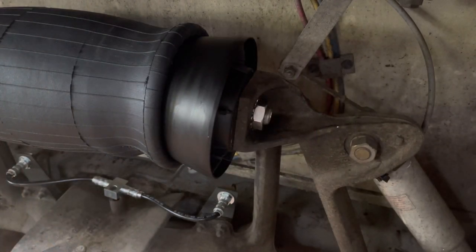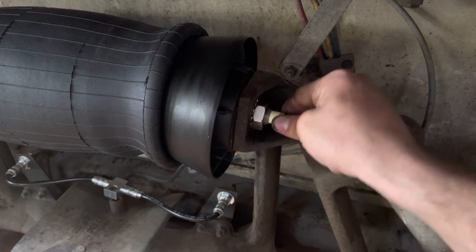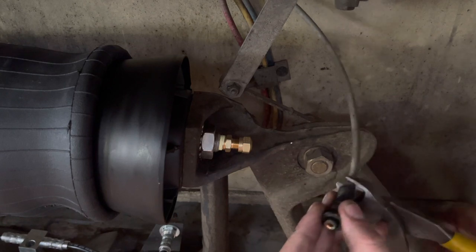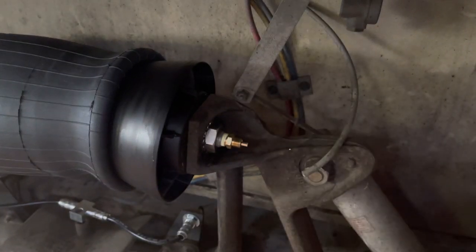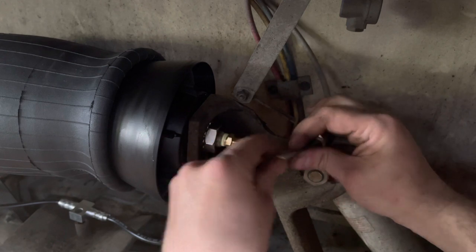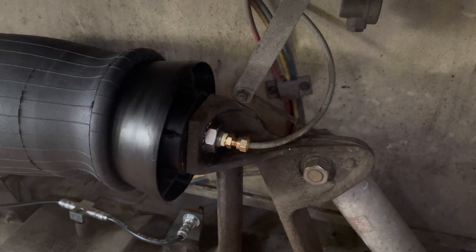It's not a bad idea to install an airbag isolator kit, but Cinnabar does have all-brass air fittings, so we'll just put those on. Thread it in — it already has a sealant on it — and tighten it down with a 9/16 wrench. Then on your airline, take a pair of dykes and cut off the old fitting, and unscrew the end from the brass fitting. Inside the nut is a little ferrule, so put the nut on the hose, then put the ferrule on as well. If you don't cut the hose clean on the end it might be a little tough, but shove that on and tighten down the nut. The nut is the same size — also a 9/16.